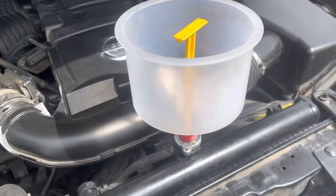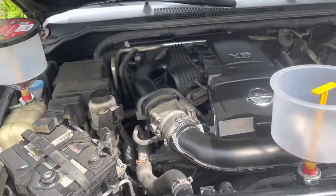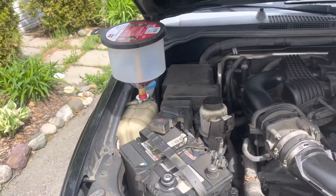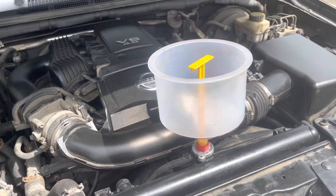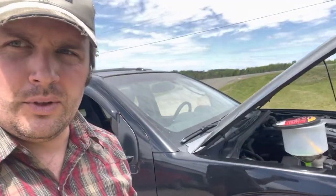We're going to pour it down and start thinking about getting the air out. There are much better videos than mine on how to do that, but essentially we're going to fill it up, turn the heat on - that pesky rear heat too - run it on high, and just let her heat up and blow the air bubbles out. We'll fight with it for a while. Here she sits - it's been bled. We heated it up, cooled it down, got the bubbles out. That funnel was full and it's been drinking it over time; we'll fuss with it a little bit and eventually it'll all work.